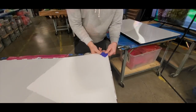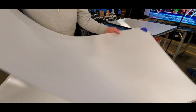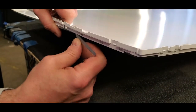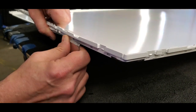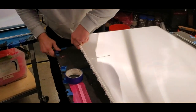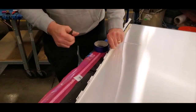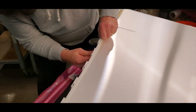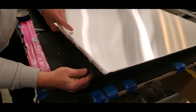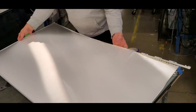For the layers of diffusion, tape them in the corners to keep them in the order that they came in so that it is easier when you put them back. Remove the filter frame around the TV. Be very careful when doing this so as not to break it. Then lift and remove the reflector sheets.